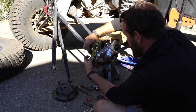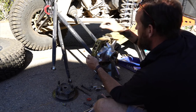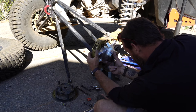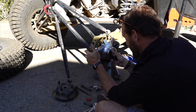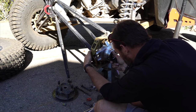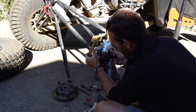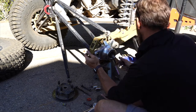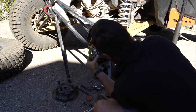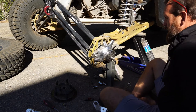One thing I'm probably going to have to do when this is all done — and again, why I like these assault industry radius rods — is since that thing had so much play, I'm probably going to have to readjust the rear alignment just a touch when this is all done. It's as simple as just loosening up the jam nuts and putting a big crescent wrench on the rod and giving it a twist.